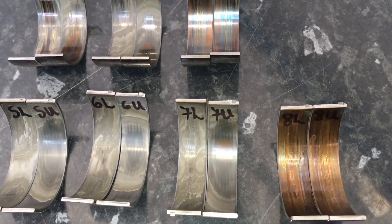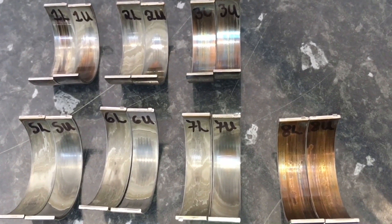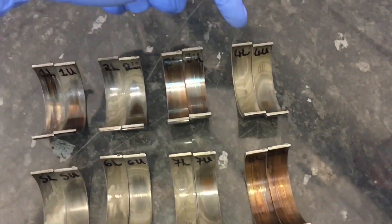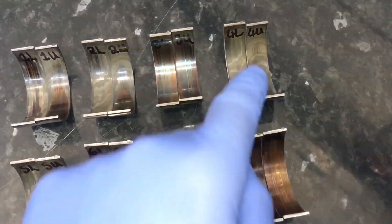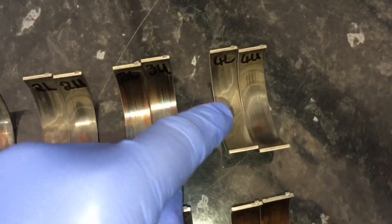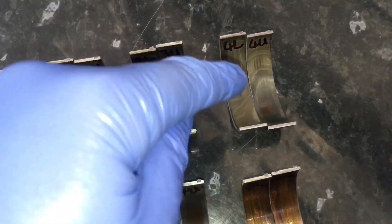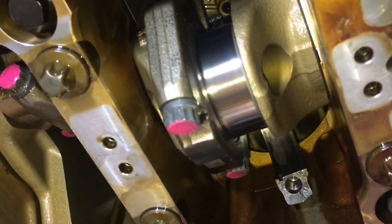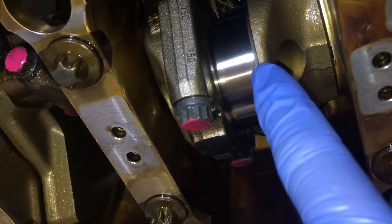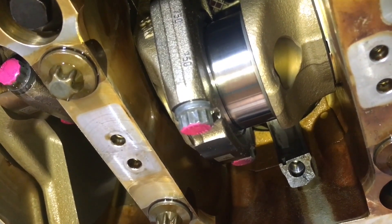That is another good indication why this car is at 112,000 miles. But what is a good thing to consider — con rod bearings, even if you think they might be absolutely fine, you just never know until you take them out and start looking at them. I've just taken out the final set, cylinder number four. It's quite amazing that cylinders four and eight run on the same journal and yet look at the state of that bearing set versus the other. Comparably, cylinder four shows visual wear — patches and copper visible — but you could argue it's still serviceable, whereas cylinder eight clearly wasn't. And look at how perfect and polished that journal is — exactly what you want to see on a crankshaft journal.